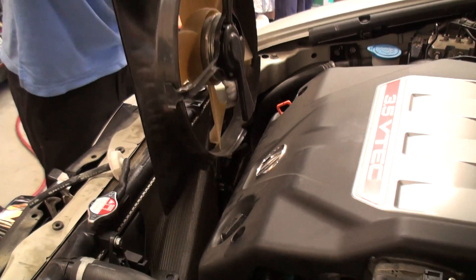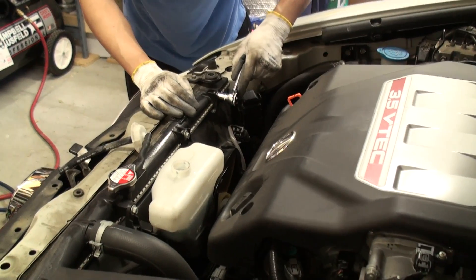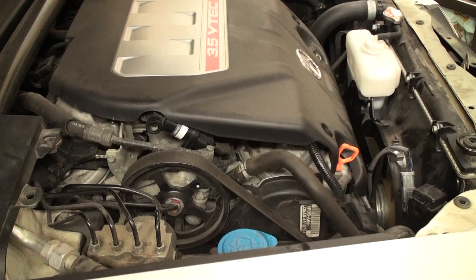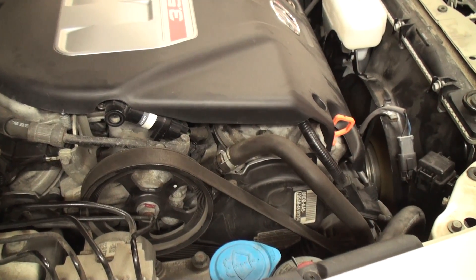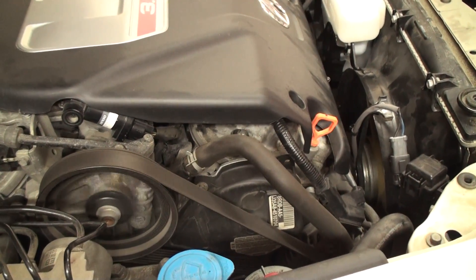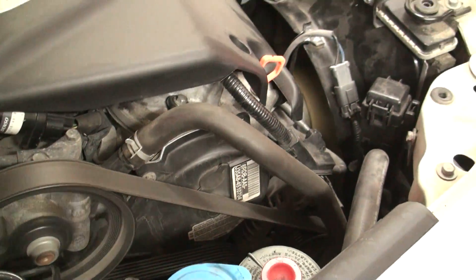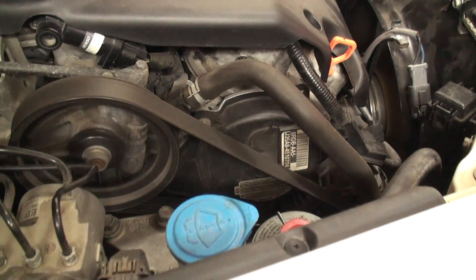Reinstall the AC condenser fan, paying attention that you attach any clips that were removed earlier from the fan shroud. Retighten and reinstall all the different components and screws originally removed during the compressor bolt replacement process. Prior to reinstalling the lower and upper engine covers, double-check to make sure your belts are routed properly, all wires are connected, and that nothing has been left incomplete. Start the car to verify that the sound has disappeared. Turn on the air conditioning system to verify there is no noise, and verify that the AC condenser and radiator fans activate when the air conditioning is turned on. If all checks out, shut the vehicle off and reinstall the engine covers.